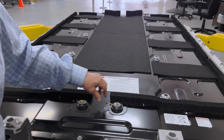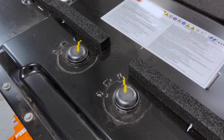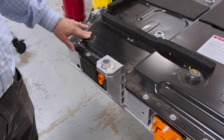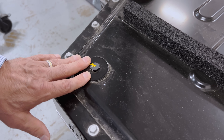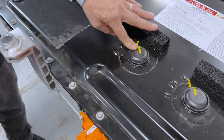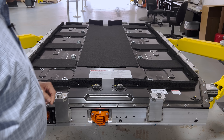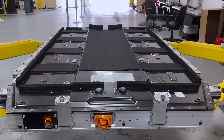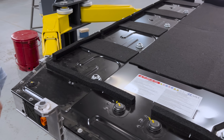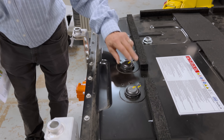From previous checking, these are all not live connections, so they're safe. You've got a couple of vents here that allow for the equalization of pressure between the internal of the pack and normal ambient pressure. We also have some Gore-Tex type vents here that are meant for rather slow equalization of that pressure, and these for more large flows such as what you might have during a thermal runaway event. There are more of those vents in the back.